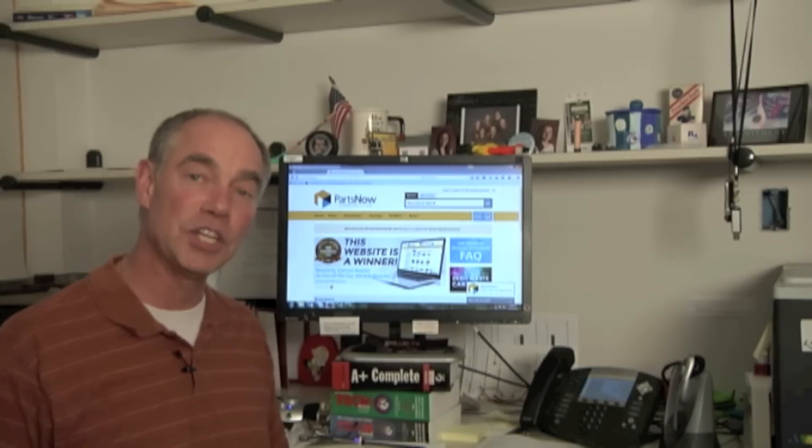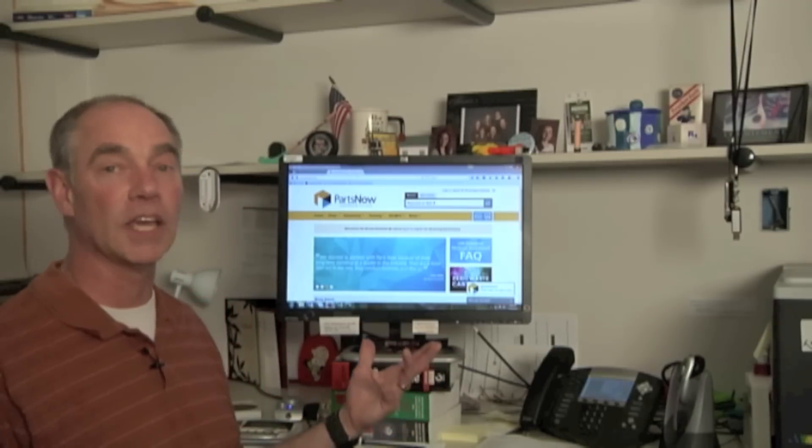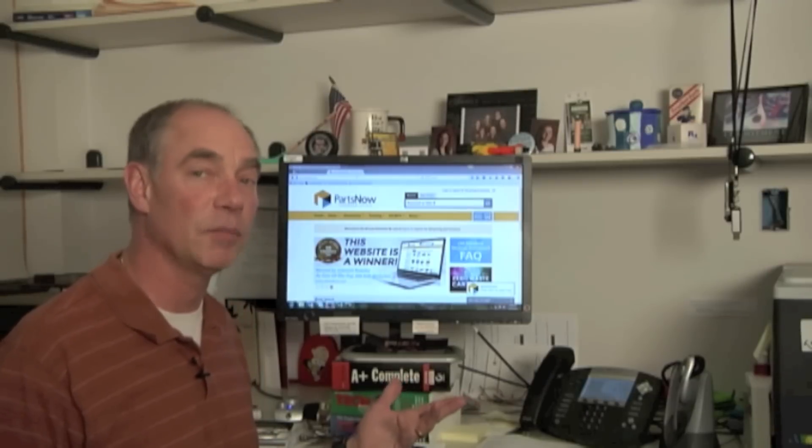One of the first things is I need to know: do I need to do a firmware upgrade? Does the machine really need that? Is that part of the troubleshooting process? Oftentimes people will get 49-type errors, and a lot of times those tend to be communication-related errors where a firmware upgrade is necessary. Inside the firmware files, as we get to downloading, there's a README inside there as well that tells me all the fixes that this new version addresses from prior versions.